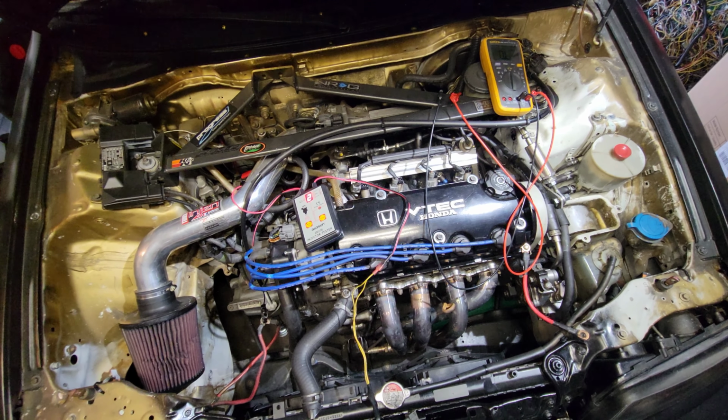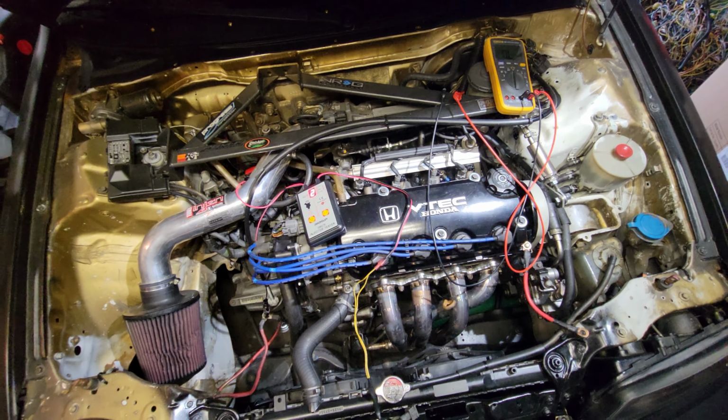Alright, so after a bunch of trial and error, I discovered that regardless of if those injectors work or not, they are low impedance. And the Z6 engine, which I have in here, is the OBD1, which is a high impedance. So after going through, I checked all of these guys. They all click perfectly. All the ohms measure out 11.9. So I'm going to end up using these. I'm just going to have to put the new filters and O-rings and stuff on that, and just swap them over onto this guy. No big deal.